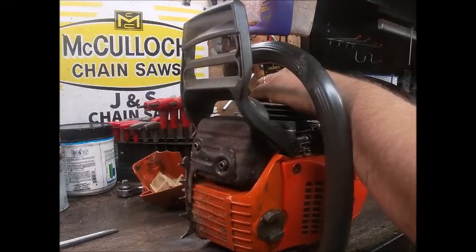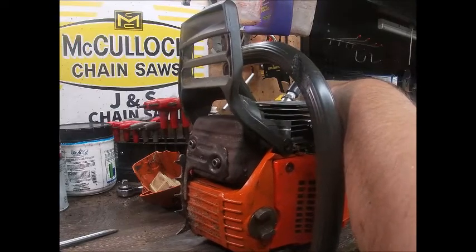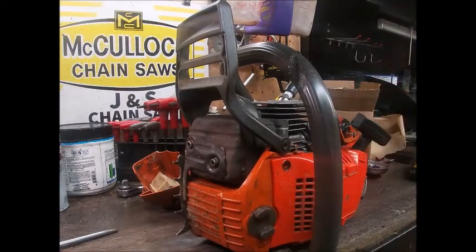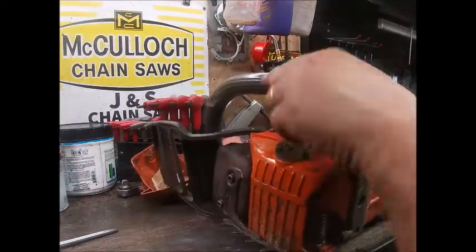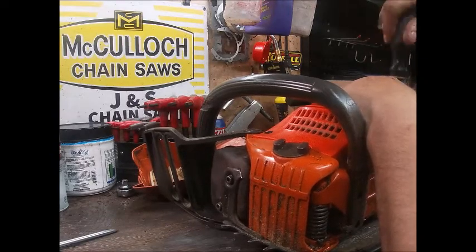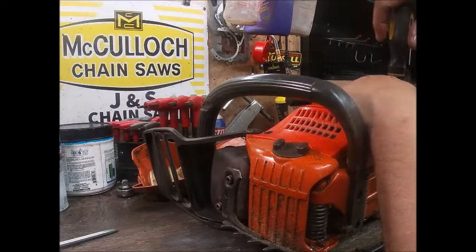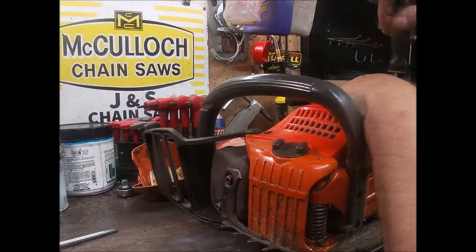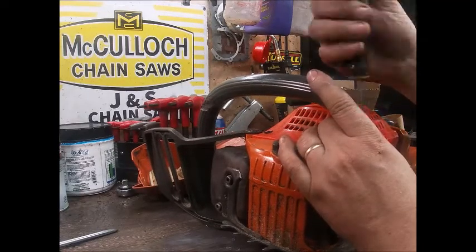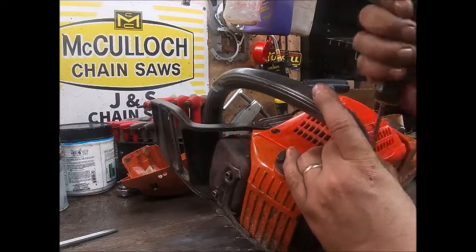You can block sand the top of that pin or base. I know there's going to be people who frown on that — I really don't care. You can remove the material as long as everything ends up being flat and true. This saw ran good. Justin had commented it looks like it runs good for what it is, which it did. It's strong, and most people would be happy with it. I think it's 48.5cc's or so. I could make this cylinder stronger, but at the end of the day it's an open port cylinder. I just don't think it's going to do what I want — I'm talking in that 14,000-plus territory and still retain a little bit of grunt. I just don't know if I would have ever got 14,000 out of that. It just wasn't zippy enough to suit me. It held RPM good in the cut, but it was low RPM.